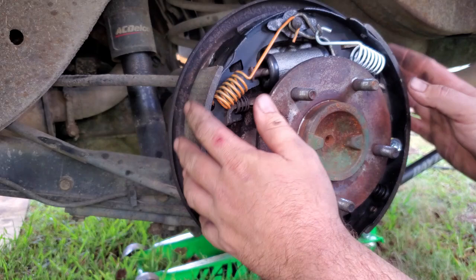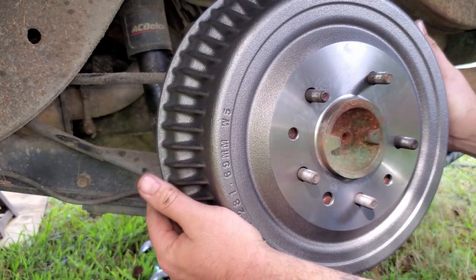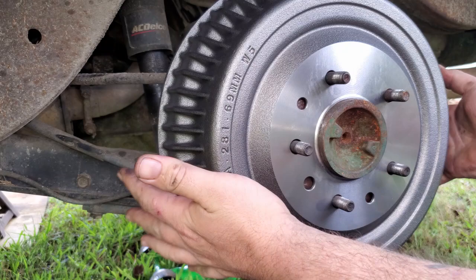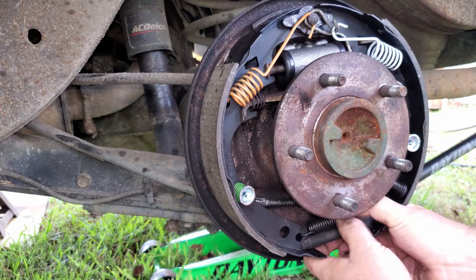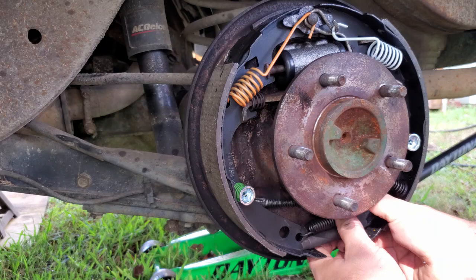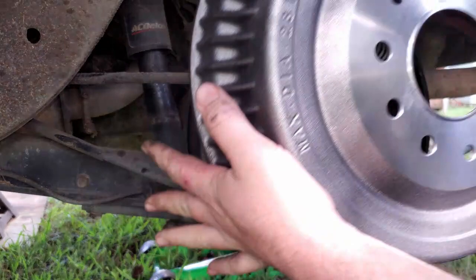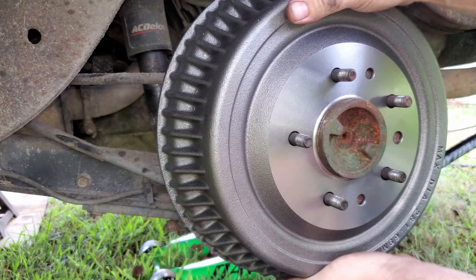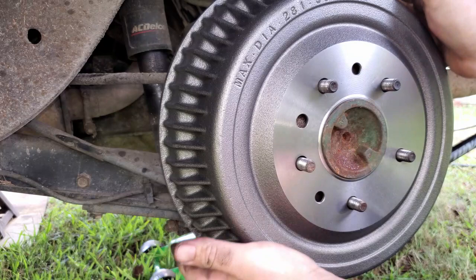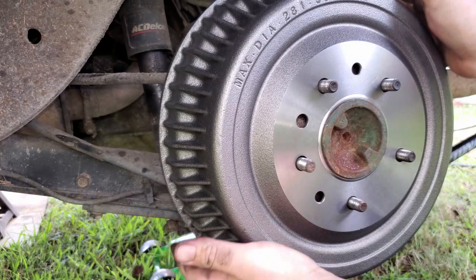What you're wanting is to feel a little bit of friction on your brake shoe with your brake drum. Right now we've got none, so pull that out and adjust this. You can move that little lever up and down or you can just pull it and turn the wheel - either or, it all does the same thing. I think this might be a little bit tight - I'm gonna back it up about a turn or two. There we go, I like that - that feels pretty good. So we're gonna leave this side and I'm gonna jump and do the other side alone so I can do it faster.